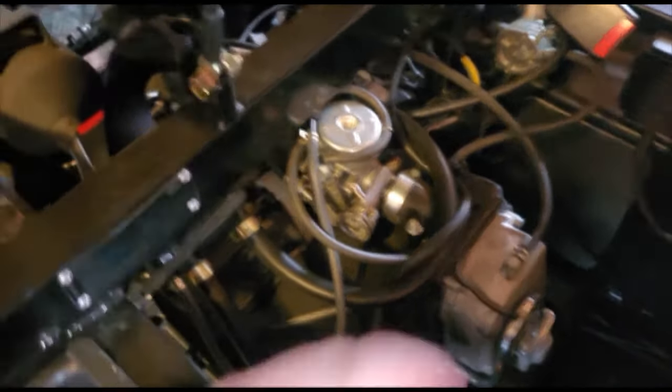So the first thing is those two pins. There's a cotter pin right here and a matching one directly on the opposite side. These little hooks right here go around this plastic and just butt up against it — it vibrates a lot but there's not much you can do. I'm going to try wire-tying it to keep it tighter, because you really can't put any padding around the cotter pin or it won't fit. Then lastly, down here is the third pin where a ball hitch could go if needed.